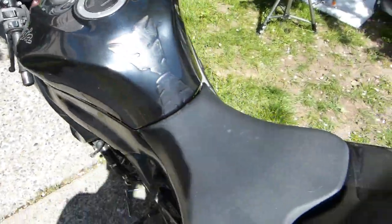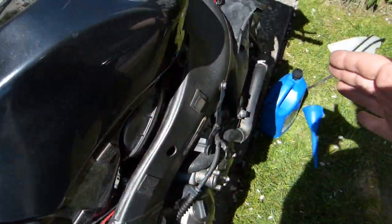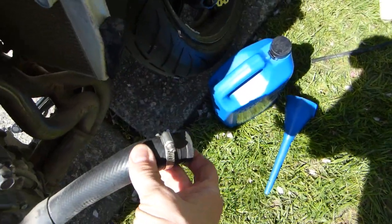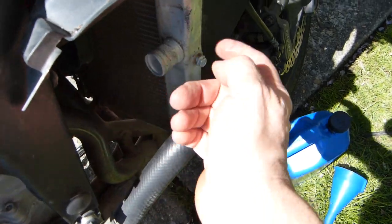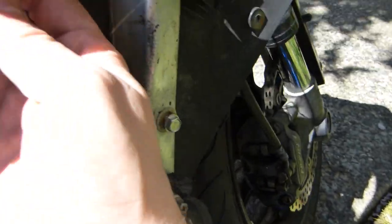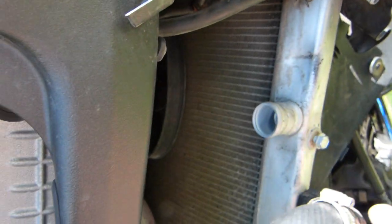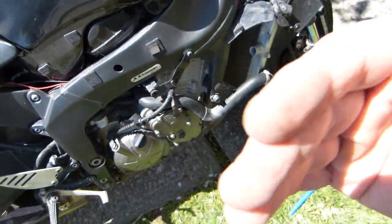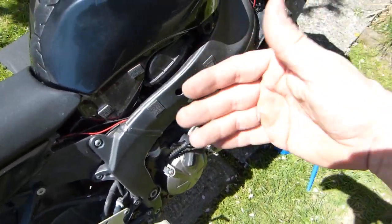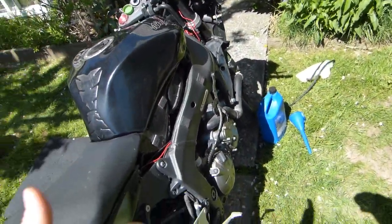Again, it's based on its softness, and I want to flush out, and water is gushing out here, water is also gushing out here. It's going to partially refill the radiator because water is going to come through the smaller hose, so it's going to run down here, and that's how I flush out this system. Okay, I want to forcefully dislodge any sediment wherever it may be stagnating or settling in the system.